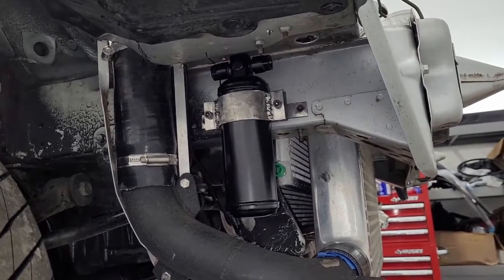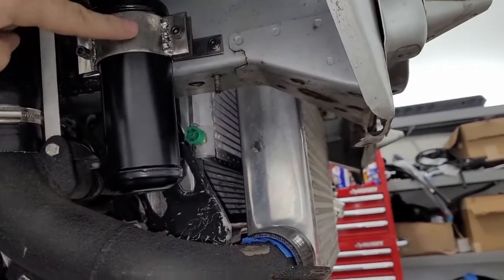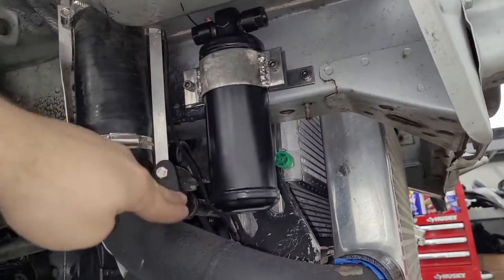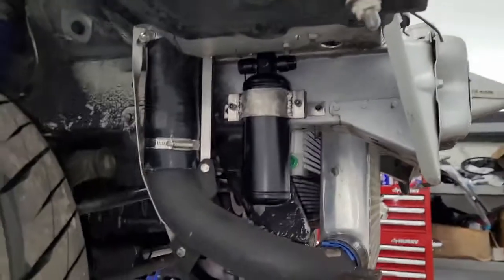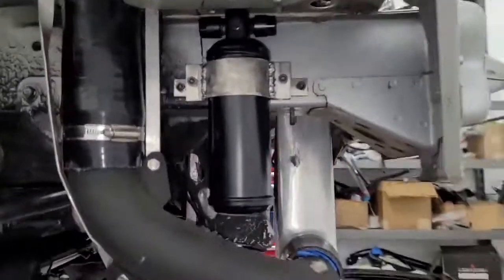So like this, if this had the AC fittings on it, I could actually take this bracket off and leave the AC fittings hooked up. You would just basically loosen these two bolts, or take these two bolts out, and this cover on the top comes out. And then if I loosen the back bolts, the whole back of the bracket would slide down, and I could remove it and just leave it hanging on the hoses. So I will be able to remove this to paint it later, whenever it's time to do that. So anyway, yay for progress.